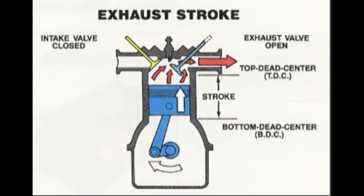This is important because people think about exhaust as a continuous flow, but exhaust flows through the tubing in impulses — it's not a constant flow. It's a pulse: every time the exhaust valve opens, the piston comes up and pushes that exhaust out, and that happens once every two complete revolutions.